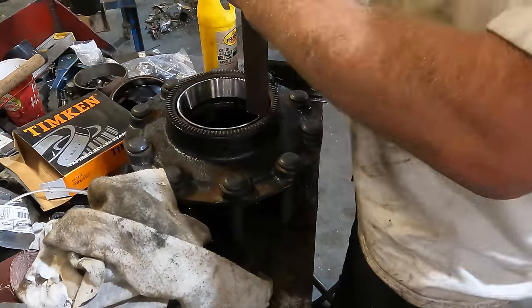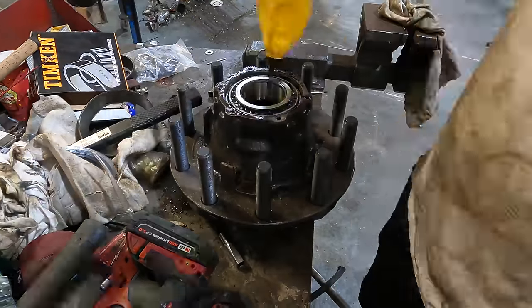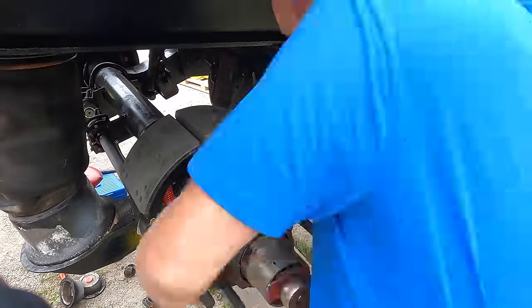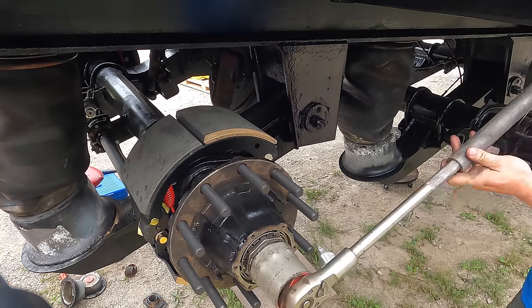All the hubs got brand new seals, and I did look at pricing a replacement hub because it comes with the longer studs, so you can put a double aluminum rim on there, but it was still more cost effective to replace the seal and the inside and the outside bearings on the ones that were shot. There's only two that needed bearings. The other bearings were fine.